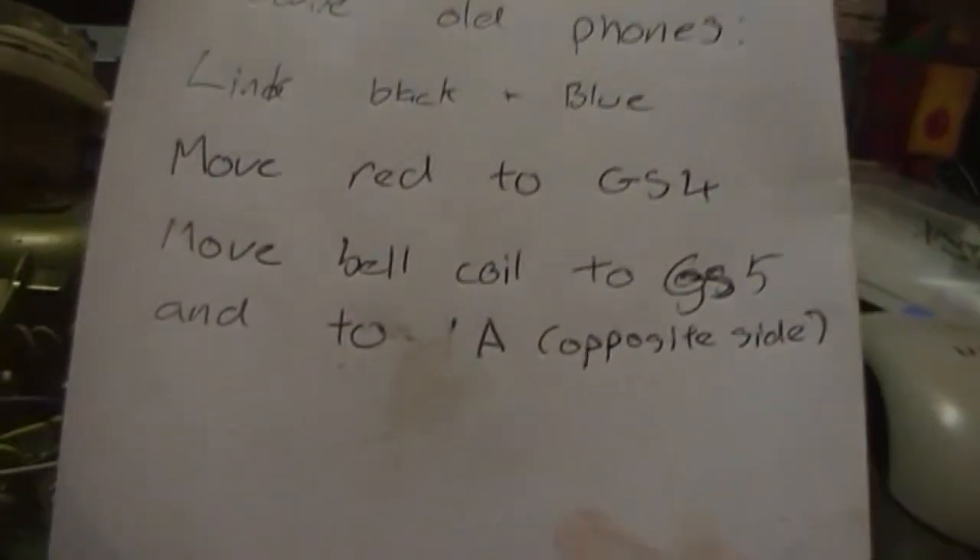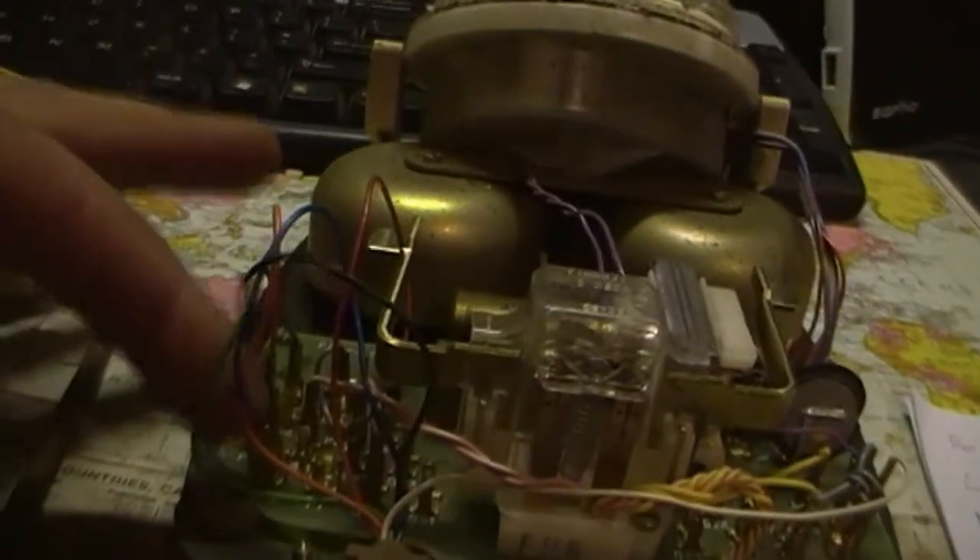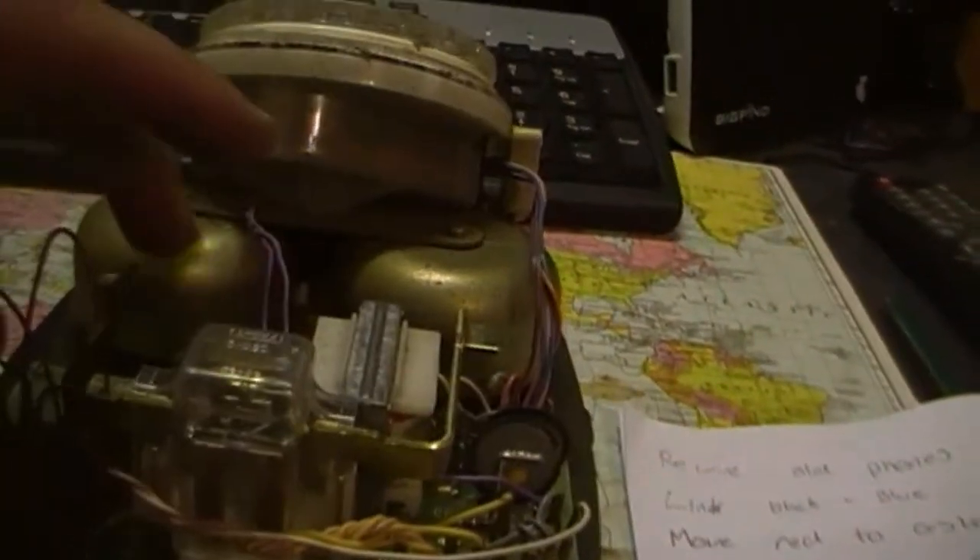Right, we're back. I drew out a little diagram, and judging by the ones I've done, sometimes a bell coil one side isn't on GS5, which is down in there - hence why I've got my reading glasses on because I can't really see those numbers otherwise. To rewire old phones, link black and blue - which means you pull the black off GS5 and put it onto the blue, where the blue is on B. Then you move red out of the phone line, where black and blue come from, and your main phone line to GS4 where the black just came from. Then you move your bell coil - which is this here - one side will either be on GS5 or GS1, but move one to GS5 if it's not there already. The other side of the coil, move it to A, which is on the opposite side, so you have to make sure it's tucked down below the hang-up cradle here.